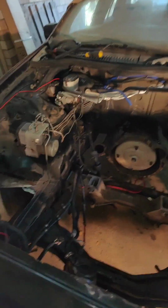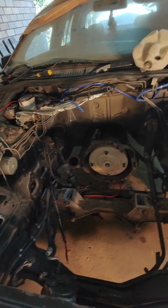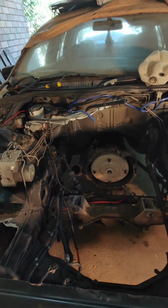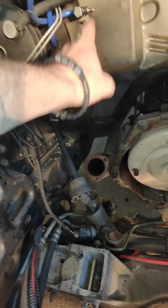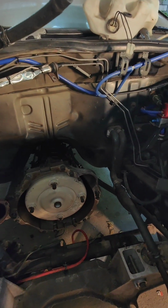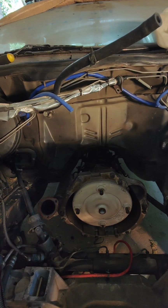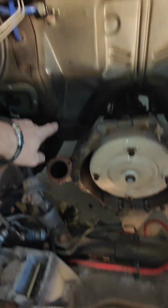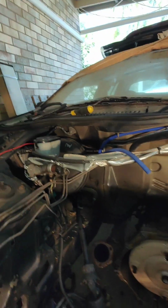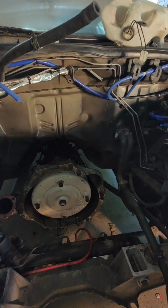I've gone along and gotten rid of the rest of the fiberglass out of there. That heat shield matting, it's all crumbling, falling apart. It's gotten rid of it, it's out of there. I'll get some stick-on heat shield stuff in the near future and stick up the back of the firewall. And yeah, probably should definitely do both sides, but we'll see what funds allow me to do. Worst case scenario, I'll just put some up this side, stop it getting to the feet on the pedals and all that, and do the passenger side at a later date.